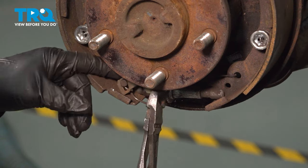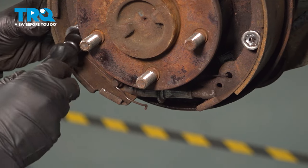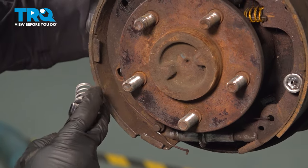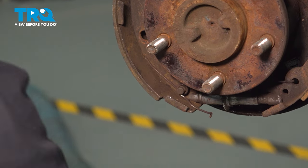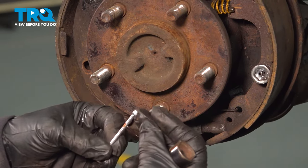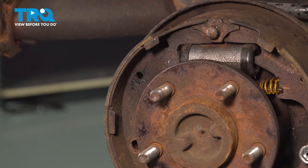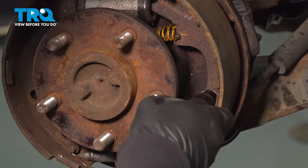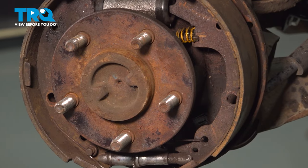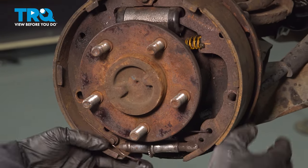Take the spring out with the shoe, using your brake shoe retainer spring tool. Turn counterclockwise and take the pins right out — examine them. If they're old, make sure the T-top piece is still in contact and not flattened, because they'll just pop off. You want it to have that nice T-shape. Place them left and right to confirm — sometimes you'll have shorter pins on one side and longer on the other, so you don't want to mix that up.